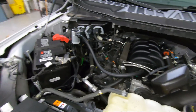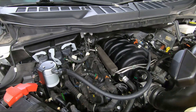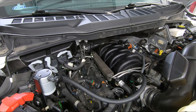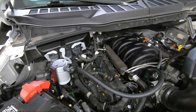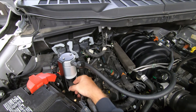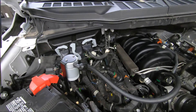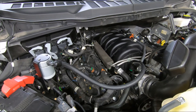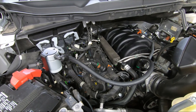Check your oil separator after a thousand miles of driving after install — you can use our little reminder stickers or set a reminder in your phone. Your average collection on most of these 5-liters is about an ounce of oil every thousand miles. The can holds three ounces in its default form. We do have an optional extension that will double the capacity, which is very convenient for people in cold climates, as you will see some condensation or moisture buildup in the colder months. If you have any questions, please reach out, and we'll see you on the next one.